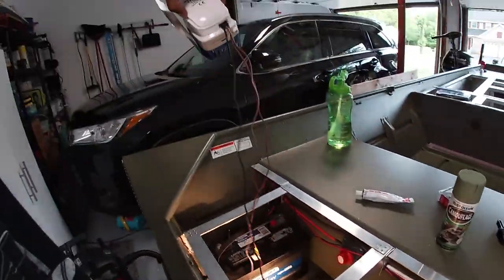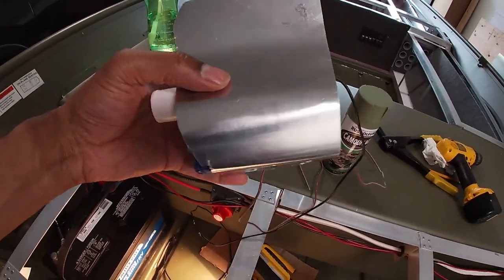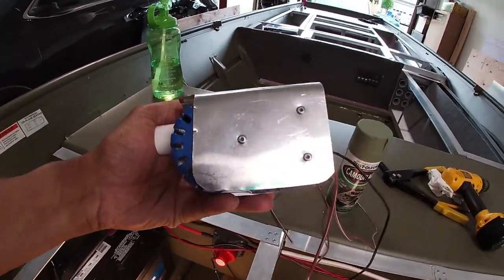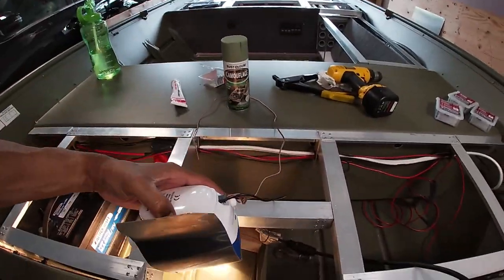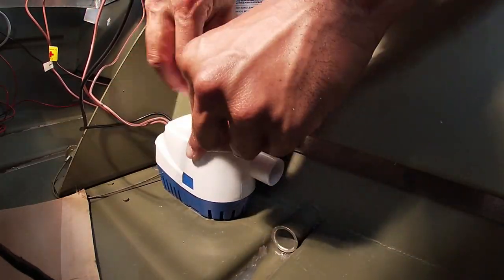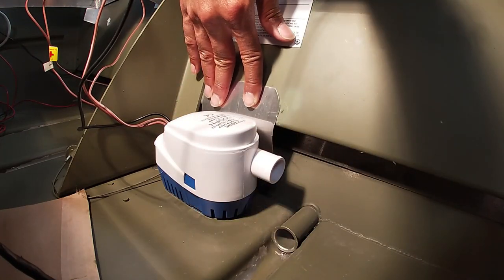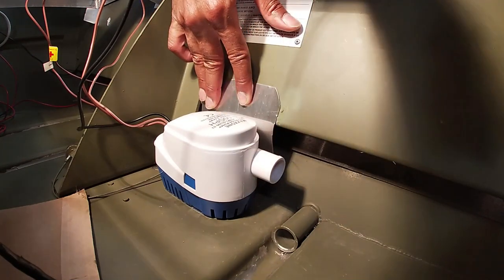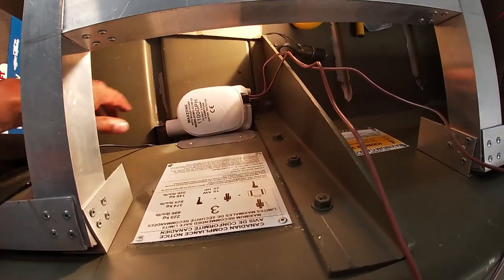Next steps for the bilge pump — let me show you what I did. I riveted a very thin aluminum — 0.019 thickness — cut out a piece that matches the base of the bilge pump. How this works is it's riveted and I'm going to bend it into shape so it fits properly and holds the bilge pump up against the rear transom. I'll push down on it, bend it a little bit so it puts pressure on keeping it flush against the flooring. I'll drop about three rivets right here to make sure it doesn't move.